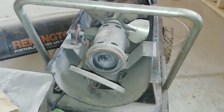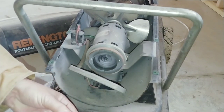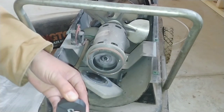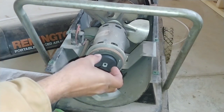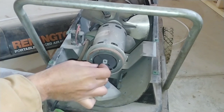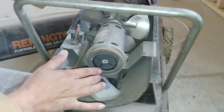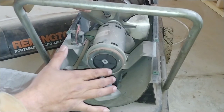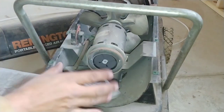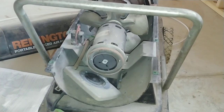Something important to point out when doing this on your heater: do not spray any lubricants, do not spray any oils in there. If you're going to do anything, you have to use dry graphite — dry graphite is the only lubricant you can use inside this thing. Anything else will damage it because you want it to stay nice and dry. This is a carbon fiber insert. The trick is going to be sliding it in while keeping those tabs out. I'll be putting a link in the description below if you need to buy your own. As this spins, these arms will slowly fall out — that is what this air pump is actually doing: it pumps air into the line, down into here, which forces the kerosene up through the hose and out the front.